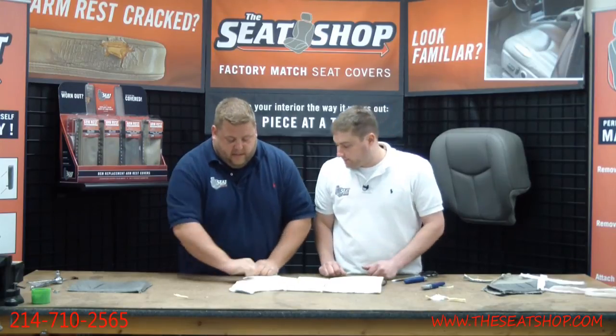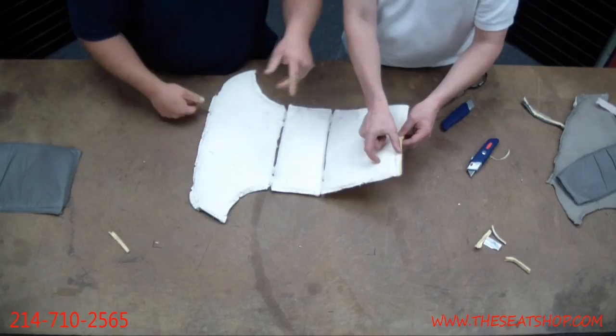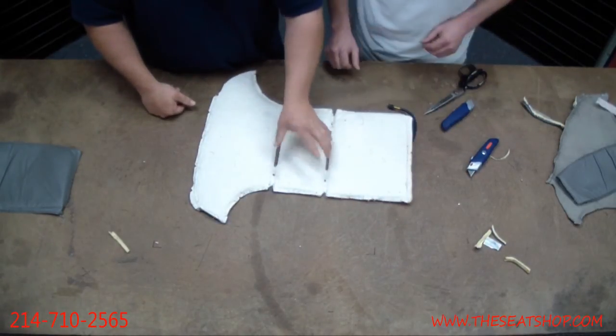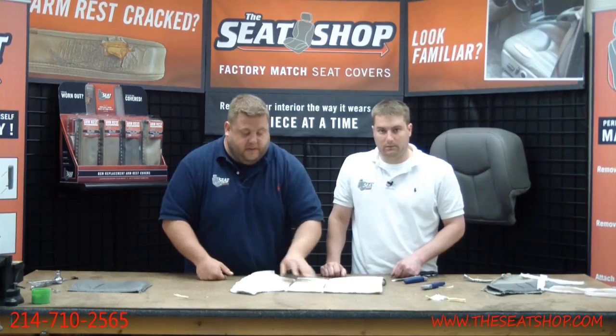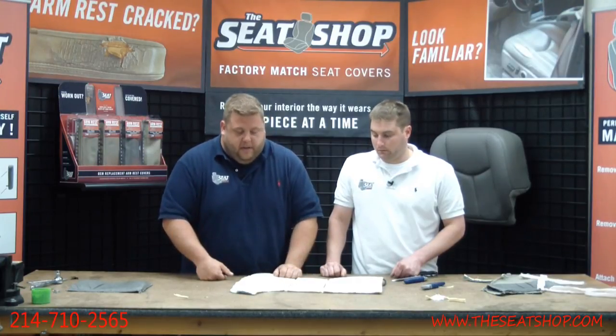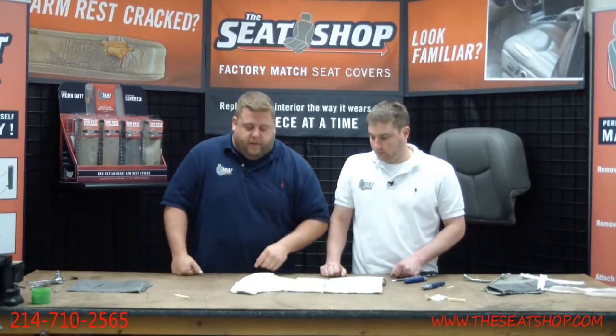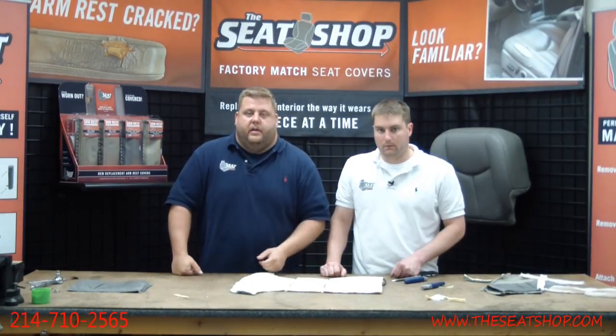There's a section here about the size of a fist that doesn't have any coils. I can put a shot of glue here, and a shot on the corners, on the tip on the back strip. The Velcro of the leather cover is going to hold this center section square. You may put a little shot of glue on each side of that. Other than that, you don't need a massive amount of glue in there because the cover is going to be holding on tight, but you can glue in a couple points. You just don't want to slap a whole bunch of glue underneath the heating coil.